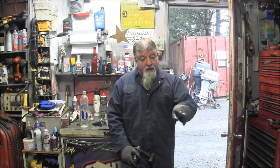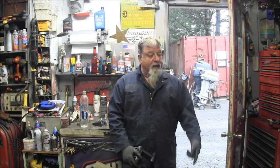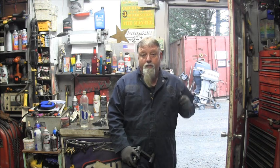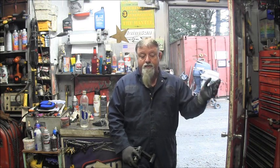And that something is about what this one's had done, which is they cut off the tilt ram, sometimes leave that dangling in there, and then they cut off or unbolt and bang out the pin that goes in the bottom of the tilt assist and leave nothing. So all you got is the two side brackets, and then they just flop around. And in this case, it's had a hole drilled through each side of it where a big pin goes through, and that stops it from kicking up in reverse and keeps it down. But if you want to tilt it, you're pretty much going to have to wait until you get it on the trailer or on a beach or something like that.